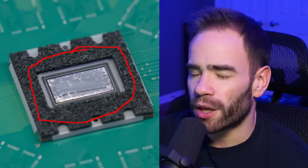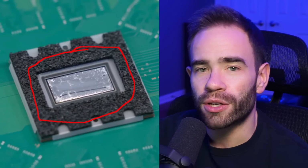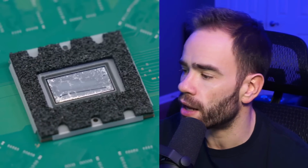However, the more I've really thought about this and some of my experiences with liquid metal, if you've had your PlayStation 5 on and running and you've used it up until this point and you're hearing about this a year later, to be honest, you're probably fine. And the reason I say that is because liquid metal does react to other metals. In fact, if you use it on aluminum, it becomes a serious problem. There are many people, you can go on all kinds of different forums and subreddits, where their CPU is seized to the heatsink because they used liquid metal on an aluminum block, and it'll actually almost merge to it. It's pretty wild stuff if you leave it there over time.